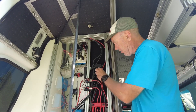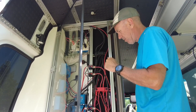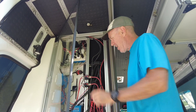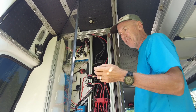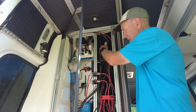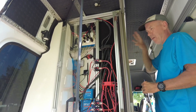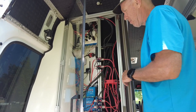Having the batteries back here works because you can't do this with regular lead acid batteries — they need a vent and there are other issues. But with lithium, they can be stacked any which way. And with lithium, fingers crossed, there's a 10-year warranty on them. We won't own the van in 10 years, so they won't need replacing. But if they do, I can pull this panel out and pull out individual batteries without any issue. It really worked very well.